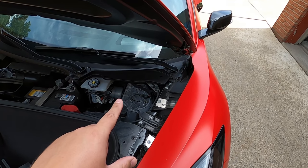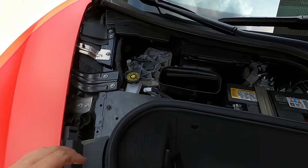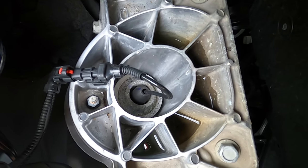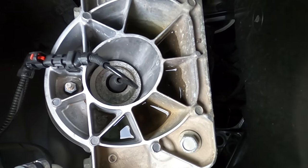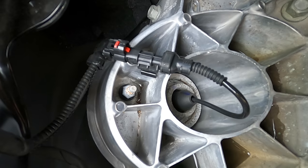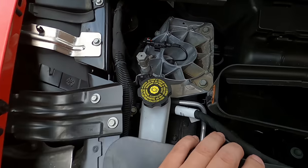If you plan on keeping the car for any length of time, that could be a real concern. Especially on the passenger side, there's a lot of water — every one of these nuts except the very outside one has water in it, and actually that one does too, just not as much. These ones are literally filled to the brim. And as you can see on this strut nut right there, there's already rust forming on it. I haven't even had this car a year yet and that is already getting rusty. This is exactly why we're going to do this fix today.